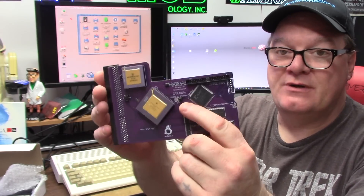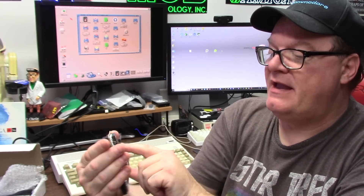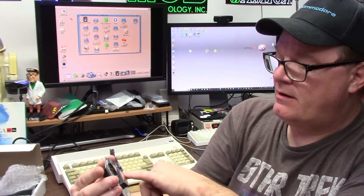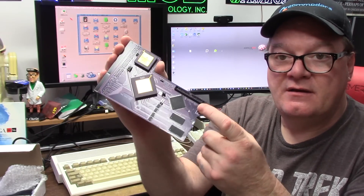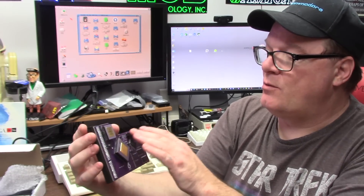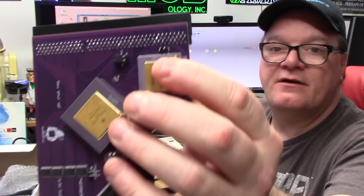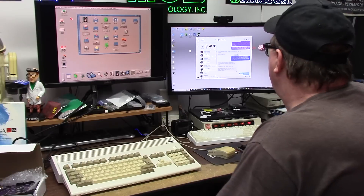We have a jumper to knock it down to 25 megahertz on the fly for maximum compatibility, enable 030 or not. There's a hard drive LED for when you're using your EHIDE dot device, a power header for a potential fan if needed, and a JTAG header for programming in the future. Normal 44-pin IDE header. Fan header — all surface mount, wonderful construction. Mr. Allen does wonderful builds. I'll link below where you can get them. I paid 230 US dollars for this decked-out model: 50 megahertz with a 50 megahertz FPU and 128 megs of RAM in purple.